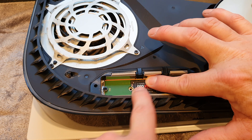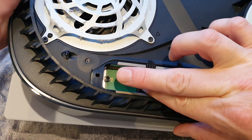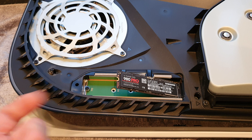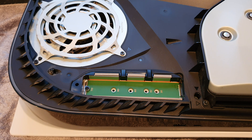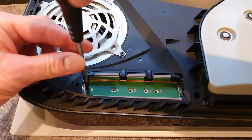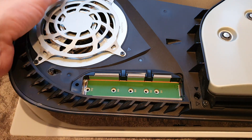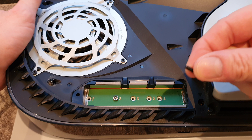What we need to note is this hole here — we have a screw and a spacer. We're going to remove the SSD for now: just let go, it will sit up, then pull out at an angle ever so gently and it easily pops out. We grab our Phillips head screwdriver and remove that screw and spacer. That little spacer will come out, and we're going to pop that into — I think it was 80 — pop that into that hole for now, and set the screw to one side.